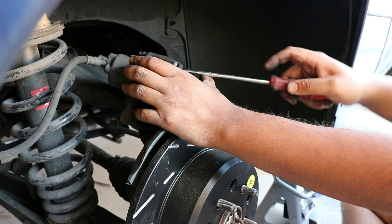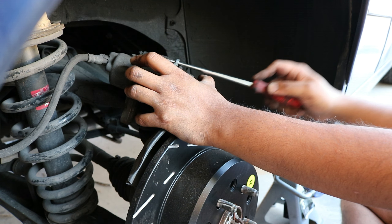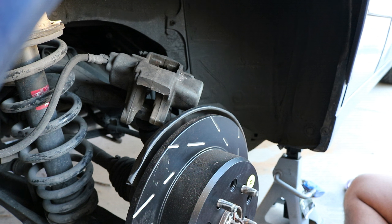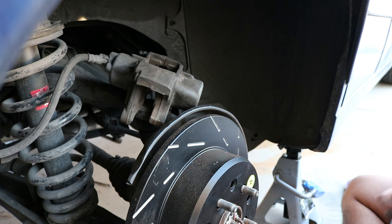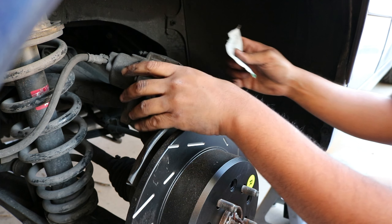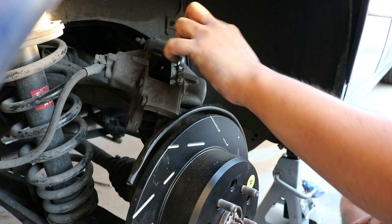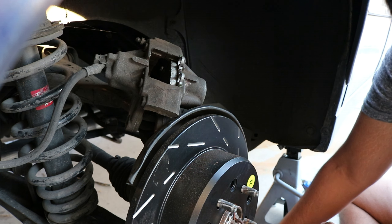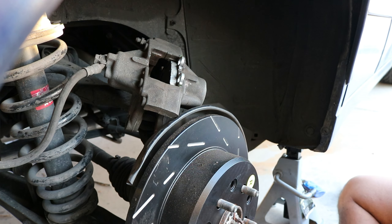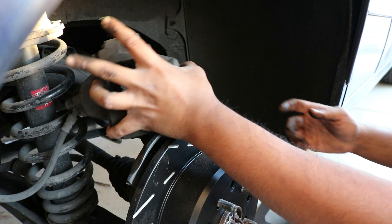I'm not too sure what's going on here. Maybe if I put them in they just work themselves out or whatever. My issue is I don't want them to freeze up inside the caliper. I'm going to put them in and see if they actually start to go loose after a while, or see if I have a bigger problem — because I think this car has had a lot more work done on this side. So what I'm going to do is put the lubricant on the side of the pad, on the calipers, at those four little spots where the brake pad will rub. Whack it in a little bit — I sincerely hope I'm not screwing up as badly as I think I might be.